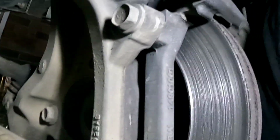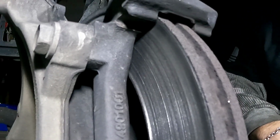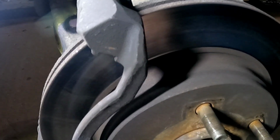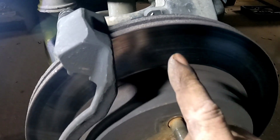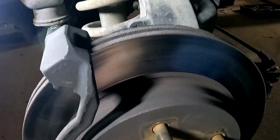And that's what it looks like on the back side. That rotor, or that pad, was just chewing that away. That is what I was talking about as a vinyl record. That's the best way to describe it. It's supposed to be super shiny like this on this side. It is not. It is gone. Like, I can have these rotors turned. They shave off a layer, the damaged layer, and then I can reuse it only one time. You can only turn these rotors one time. But I'm not going to use these at all. These are stock. I want my cross-drilled and slotted rotors. So anyway, a little bit of bonus footage.